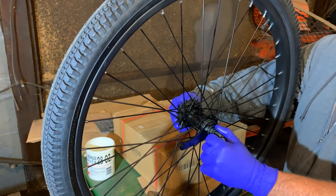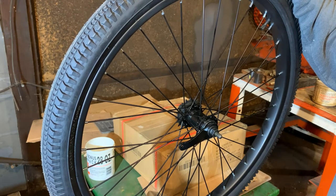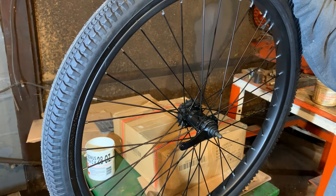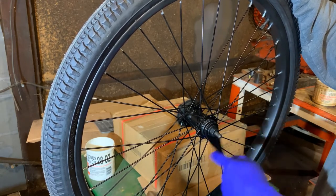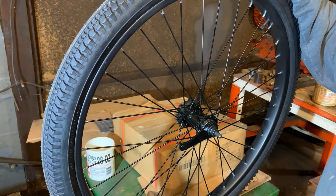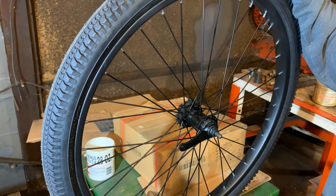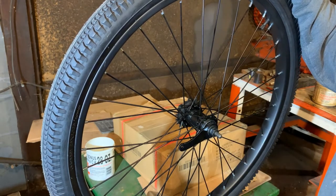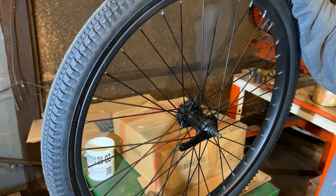I just never trust the stores — unless you buy your bike directly from a bike shop, the factories just give you a thin coat of oil which is adequate for pedaling around the neighborhood, but when you motorize it and it's going to spin a lot faster it needs more lubrication to keep it alive. If not, you'll be spending $50 to $70 every so often on a new wheel because the bearings will have run dry, eaten themselves up, possibly eating up your hub — and the only way to fix that is to buy a new wheel. It costs too much to have them re-spoke and put a new hub in; the easiest fix at that point is just a new wheel, and hopefully this time you'll lubricate it up properly.